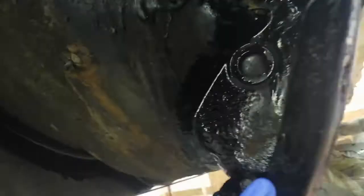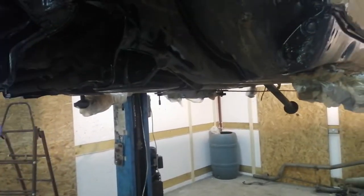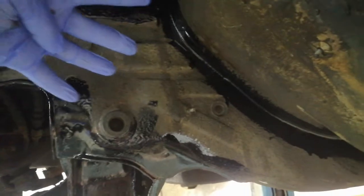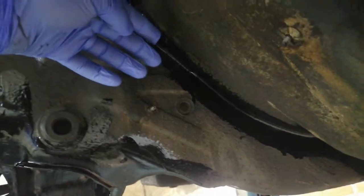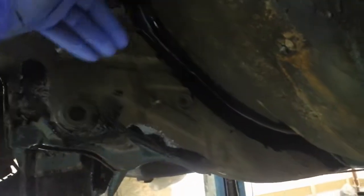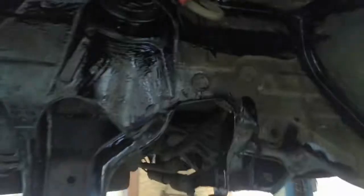inherently this area here and this area here, and obviously little edges coming along here, they're the areas where the paint will start to chip, the mastic will start to chip, or whatever coating you have will start to chip. The reason for that is, if you can imagine that's your spray compressed air, as soon as you're hitting these two areas first, the air is then pushing in. So this part coming afterwards is getting pushed back out essentially. So that's the thinnest coat you're ever going to get, or the thinnest part of your spray is always going to be in the nook and cranny like that. So going over with a paintbrush first is the ideal thing to do, and obviously then it will be sprayed after that.